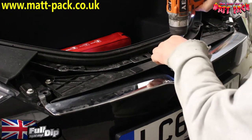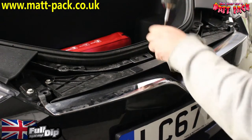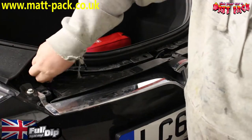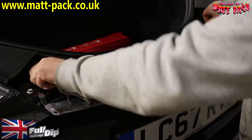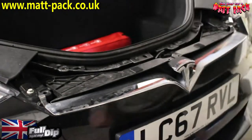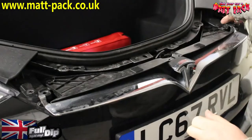The T-piece is held on by three screws — two at the top, I think they were a T25 — and there's one at the back that's a bit hard to get to. If you undo these four bolts here, you don't have to, but it just lets the top bend a bit more so you can get your screwdriver in and undo it.